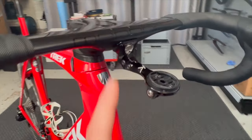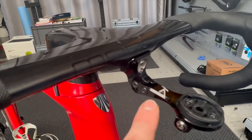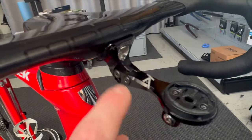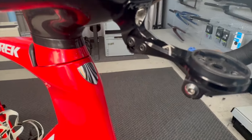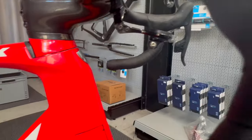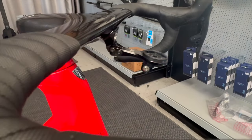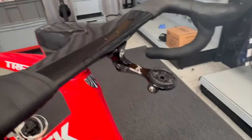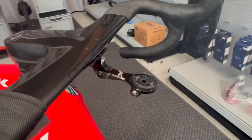Back to the handlebars — we reworked this bracket. I'm not sure if this is the wrong bracket for the bike, but the bolts were all seized up and it's been drilled out in the past. We had to rework all that, change the bolt over to a countersunk bolt so it fits in nicely. It fits a bit odd because the mount is sort of facing down — that's as high as we can have it. We've reworked it so it goes in better and touched it up so it looks nicer, but I'll have a chat with the customer about potentially changing it in the future.